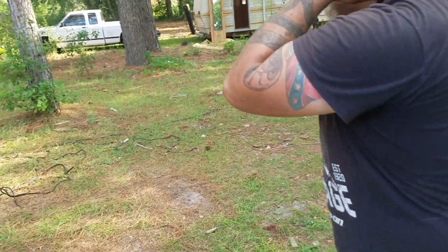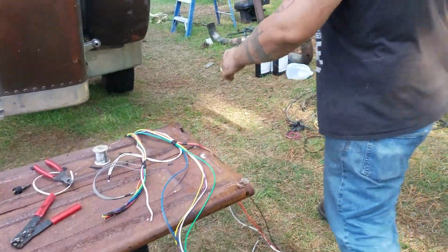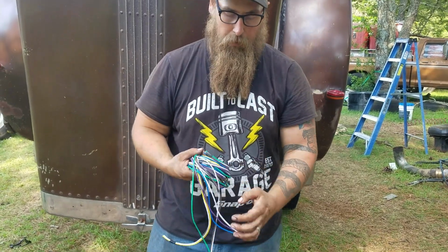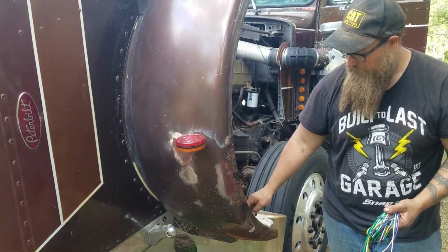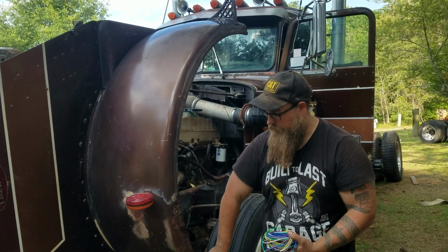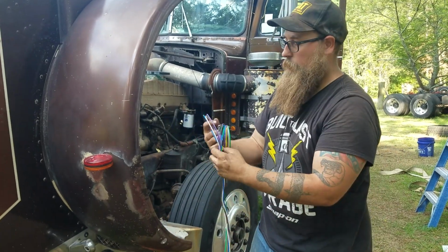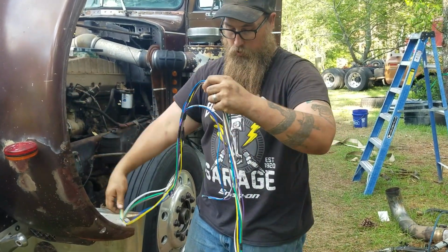Okay, cool deal. So that one, the main part of it, is built. The small tails will have looms. Which one is this? This one's the hood harness. That'd be all the forward-facing lights, the lollipops, and the little markers on the fenders right here. We don't have them right now, but it will be pre-wired in with a connector, so that if we do decide to put lights here, we've got the capability. It just looks like a roll of wire without any loom on it, but everything is already ready to go. Just needs to be loomed up.